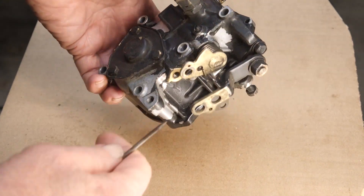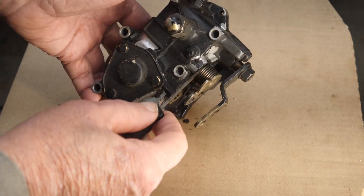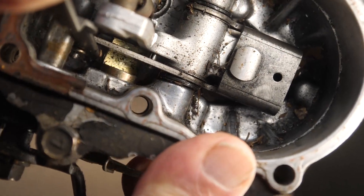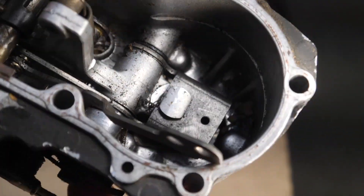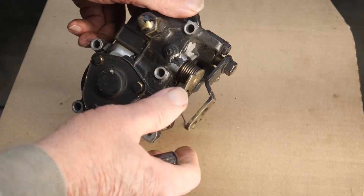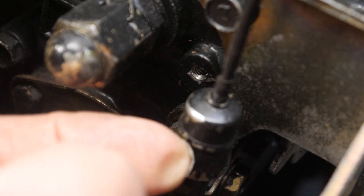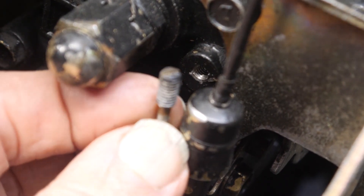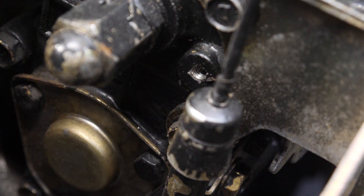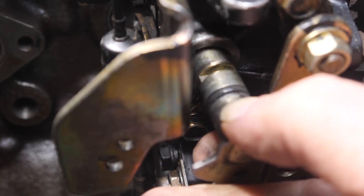This is a 755 Governor Housing. This is a fuel shutoff shaft that has a return spring on it, and there's an O-ring seal in here that might leak. It's sort of difficult to see, but we're looking at that shaft right there — it has a flat space on it. It moves this assembly to shut off the fuel or to let it flow. The way to get this shaft out is to take out this set screw in the back; it has a needle and takes a flat blade small screwdriver. It did come loose, so take that out — now the fuel shutoff shaft can be rotated and pulled out of the Governor Housing.